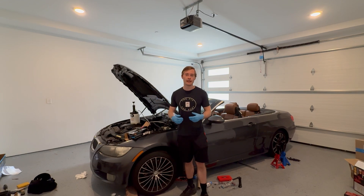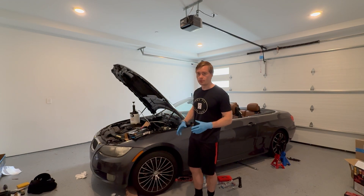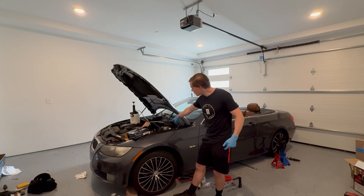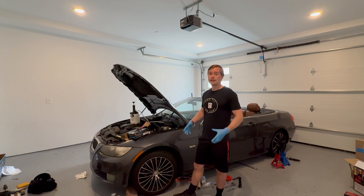The reason for that is your master cylinder has a seal inside of it that supposedly should prevent air from going downwards. So if you got air trapped in your master cylinder — maybe because you just changed out your master cylinder and there's air in it, or perhaps if you were doing a pressure bleed and you ran your pressure bleeder out of fluid and blew air into the system — you may have a lot of air in your master cylinder. A reverse bleed is a really great way to get that out, pushing fluid back up, with air exiting through the fluid reservoir.